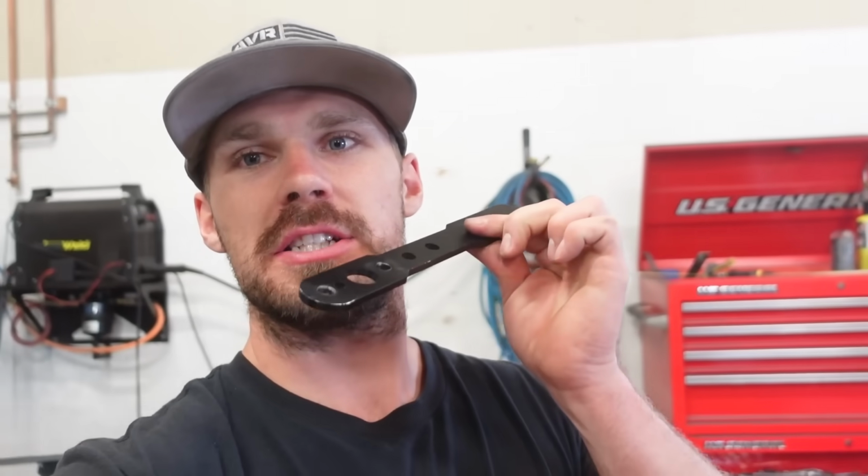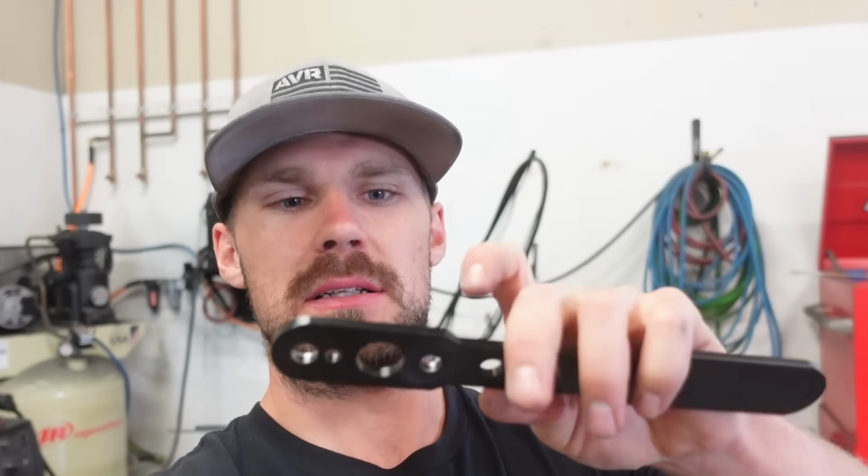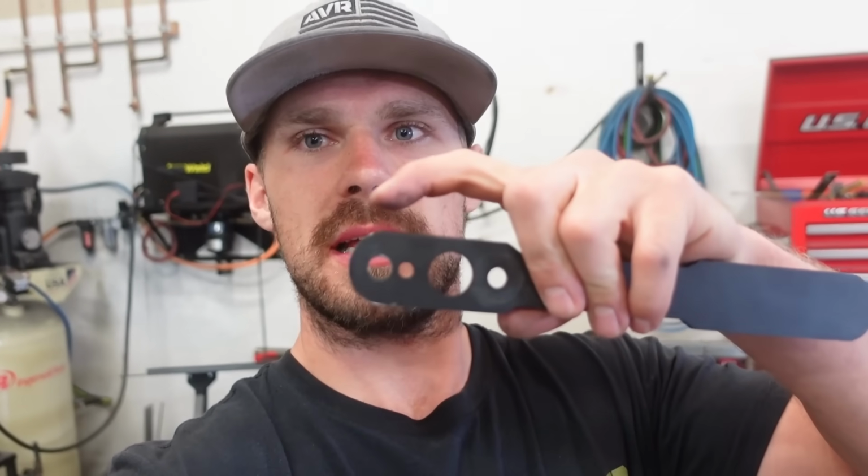All right, guys, roll cage is all tied in. We are good to go there. Now, I got the transfer case shifter handle off. This is what we got to remake. Basically, this is the pivot bolt hole right here, and this is where the linkage mounts. I'm just going to extend this down about 1 inch.